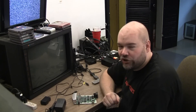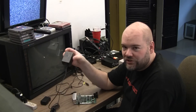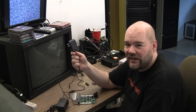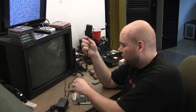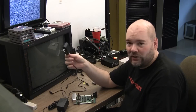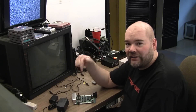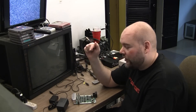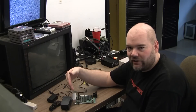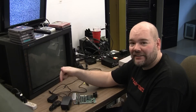Good lesson for not only testing the voltage regulator, but also testing Nintendos in general. The original AC adapter outputs 9 volts AC, but it will accept almost any kind of power as long as it's 9 volts or higher — it can be AC or DC. Of course you have to have the right size tip, and as long as it outputs probably over 600 or 700 milliamps, it'll work on a Nintendo. But you need to test with AC and DC because of stuff like this. I've had problems both ways — where it worked fine on the original AC adapter but didn't work on a DC adapter; turns out there was an open in the rectifier. I sent a modded top loader all the way to Ukraine and it failed because of that, all because I didn't test it with a DC adapter.